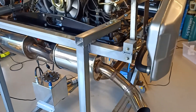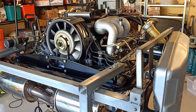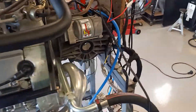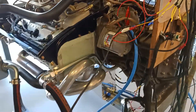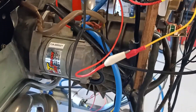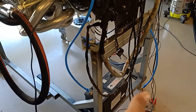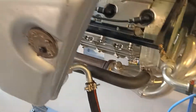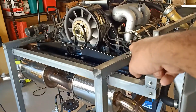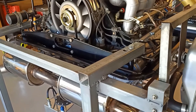I thought I'd do a quick video of my engine test stand. I've just finished building a new motor, and with the help of a friend we made this stand to accommodate engines. We've used an old 915 bell housing to mount a starter motor, welded that to this half stand at the back, and then there's another half stand at the rear where you mount the bolts for the engine brace.